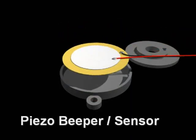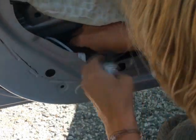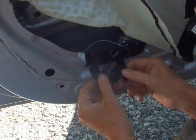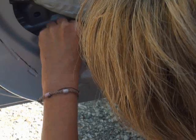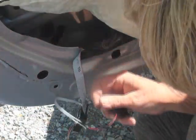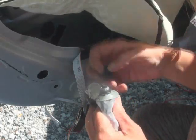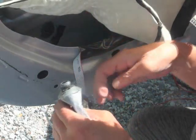The piezo, which I made a nice case for and glued the center to a disc in the middle, turned out to be very sensitive. I planned to mount it on the outer skin of the door, but the outer skin isn't really accessible. The inner skin acts like a big resonant steel drum — this did not work as it confused the processor. Good thing the goop glue hadn't hardened yet. The next thing to try was to mount it to a more solid frame that wouldn't ring, and this seems to work fine. So I applied a little bit of glue, and the tape will hold it in place until it hardens.